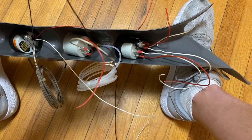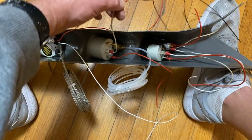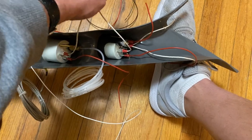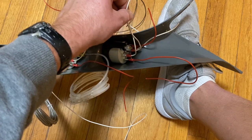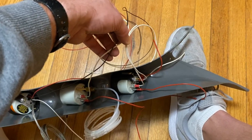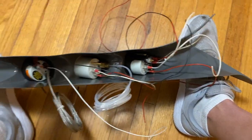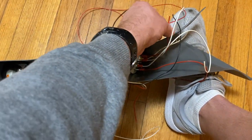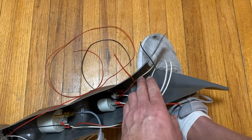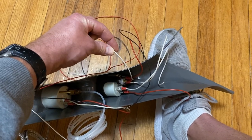And then the same thing with the grounds. We have a ground here, this ground, this ground for the boost gauge. And then we have this ground for the transmission temperature gauge, along with the ground for the lighting, and then along with the ground for the sending unit. So all these grounds can be connected together into one plug. And then the last two things is a 12-volt ignition source for both the EGT gauge and the transmission temperature gauge. So that's gonna be another plug to go to a 12-volt ignition source. And then lastly, this wire, I know all I have is red and white, so it gets confusing, but this wire just goes to the sender on the transmission.